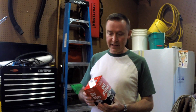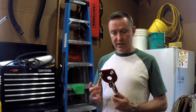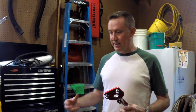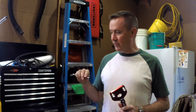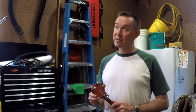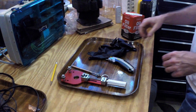We've come back to the workshop with the Champion oil filter we took out of the airplane earlier today. We're going to use an oil filter cutter to open it up, pull the element out, and use this magnet on the end of this probe to go over the oil filter element and see if we have any metal particles. That's going to be the last physical part of this oil change — the final part being the logbook entry.